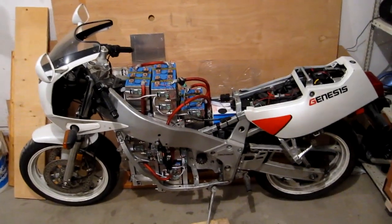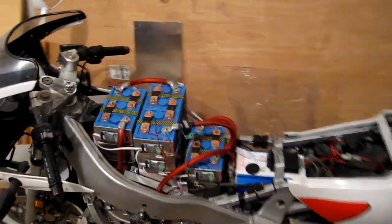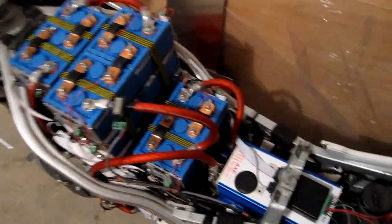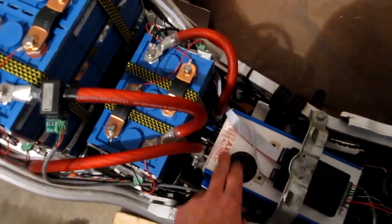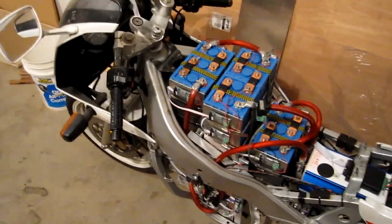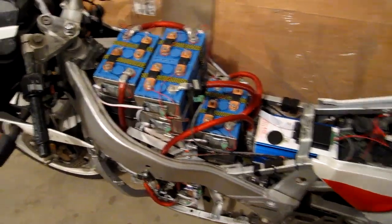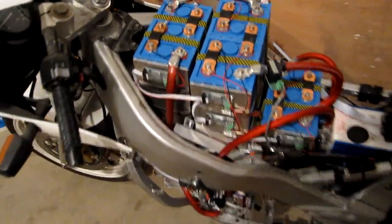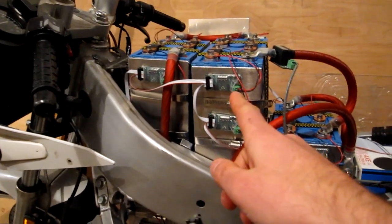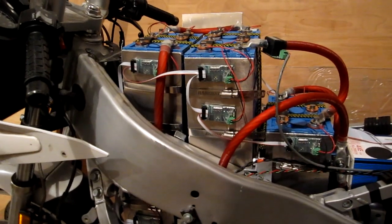As you can see this thing is just a massive pile of batteries. To interconnect all the batteries I used large zero gauge wire, and I use that also for the controller and motor connections. The remote boards which I built a while back — you'll see them all on the sides of the batteries here. Each one of those is connected to a single module or cell.